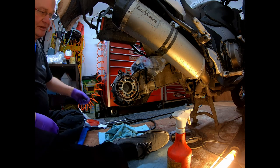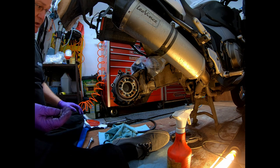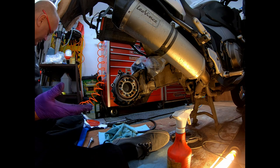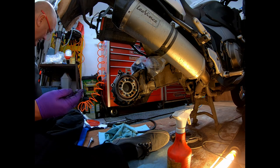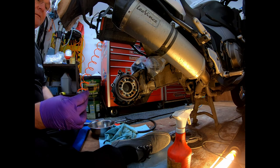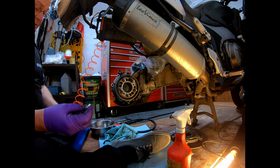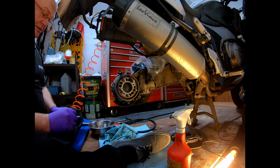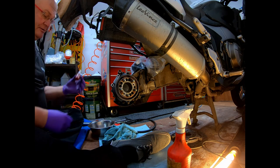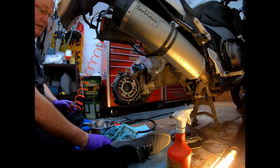And obviously these two are going to be surplus to requirement, because it comes with two new ones from Italy. So I'll just put these in a bag to keep them clean and safe until I come to use them again, possibly, and get the other ones ready. So put the new bolts. I will be replacing these for some titanium ones with seizing wire at a later date, but these will fit into the nice clean brackets. But you must put some thread lock. You can either use the liquid thread lock, or you can use the lipstick thread lock. They're all thread lock, it's all brilliant stuff.